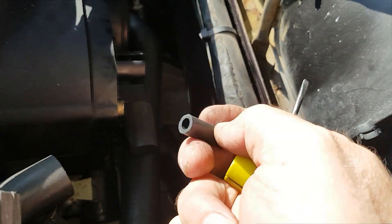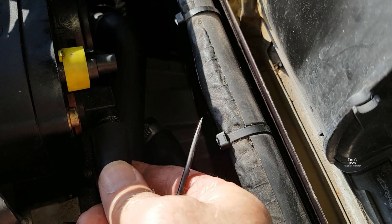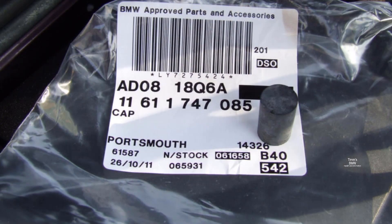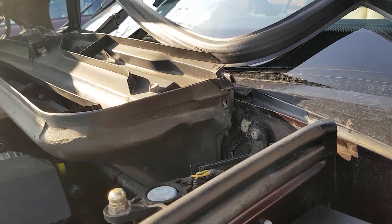That one looks fine — I replaced it five years ago. I also replaced the one underneath it five years ago, and that's the vacuum takeoff point for the booster. But in this case, even though it's only five years old, it's cracked all the way through and I'll start getting a small vacuum leak from that at some point. There's the part number. It's a simple case of replacing it — new and old are exactly the same. I've only got one because I got a number of them when I replaced the bungs four or five years ago. New one on — that's all sealed up.